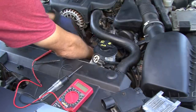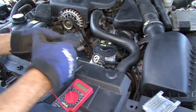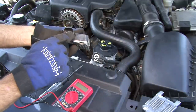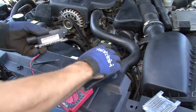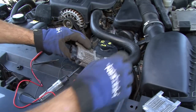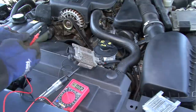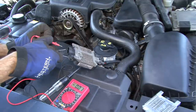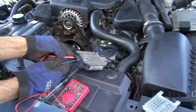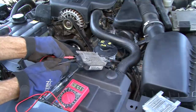The next step is to plug the old module back in. In here you have three plugs: you've got the ground, the positive, and then you've got a fan variable. With the module plugged in, what you want is no greater than 10 volts. A minute ago when I plugged it in it was 12 volts, so now it's dropping and doing all sorts of crazy voltage.